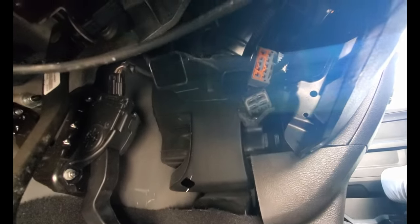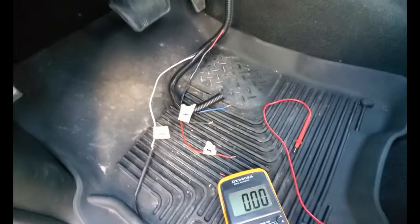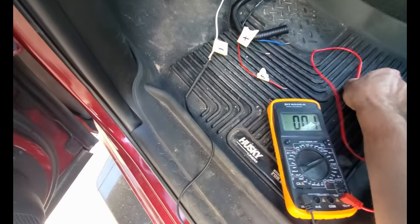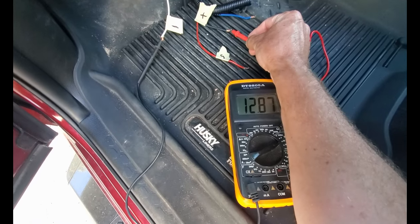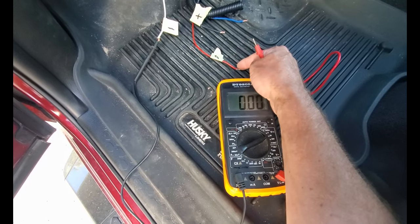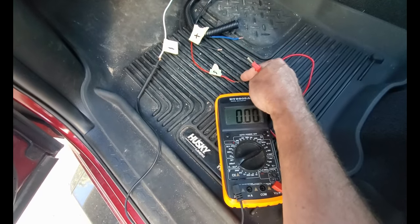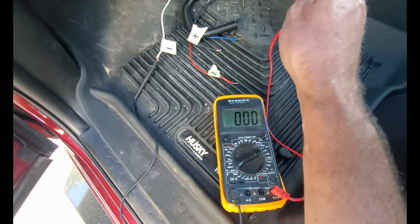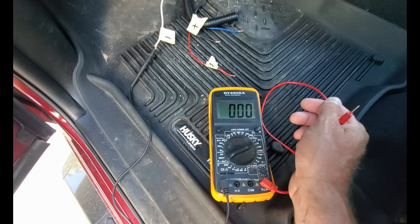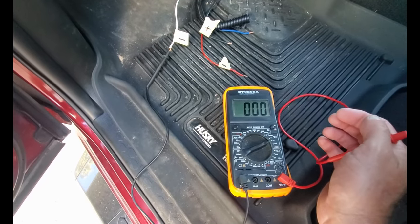This way I'm just using the one connector I need. I've already gone through these connections once, so I'll share quickly: you need a voltmeter to verify, but the color-coded wires do match the Reese controller. Negative is on the white wire, positive 12 volts is on the black wire, and blue always goes to the trailer. The red is a signal wire — you should get 12 volts on it, but the vehicle has to be running when you press the brake pedal, because this is part of the vehicle system.